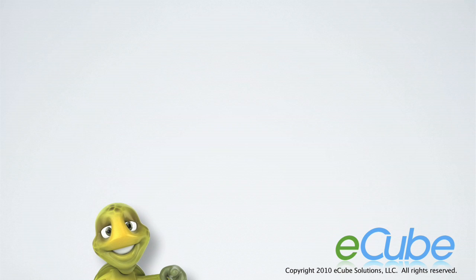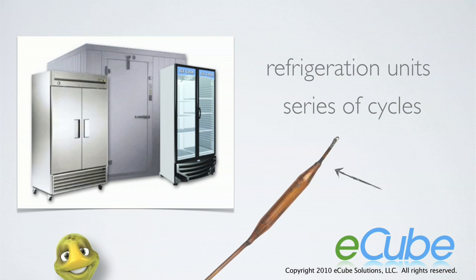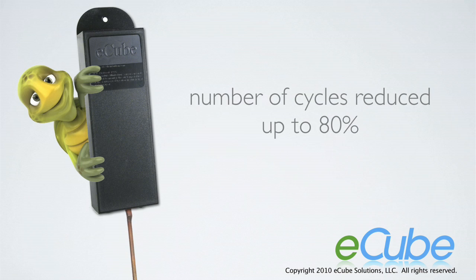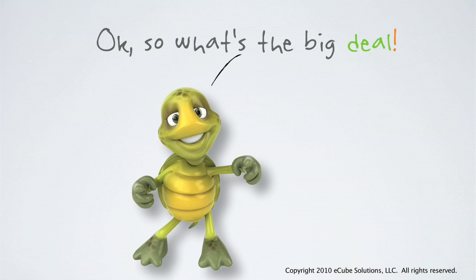Of course it does. Refrigeration units work in a series of cycles, with the thermostat probe using air temperature to trigger the on-off cycles of the compressor. With eCube installed, the number of compressor cycles is dramatically reduced, because now the probe is reading the simulated food substance inside eCube, which responds to temperature changes far more gradually than air.